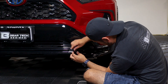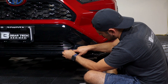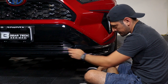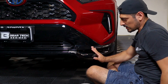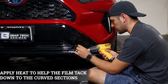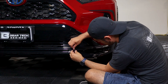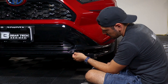You might have some fingers here. With this piece, you're going to need to apply heat because if you just install it without heat it's going to create a lot of creases. Once you get to the curve, apply heat on the film to help it tack down and sit better. Lift it, apply a little bit of heat, let the film release the tension, and then tack it down. Let it cool off and then start working your way installing the film. It should sit nicely.